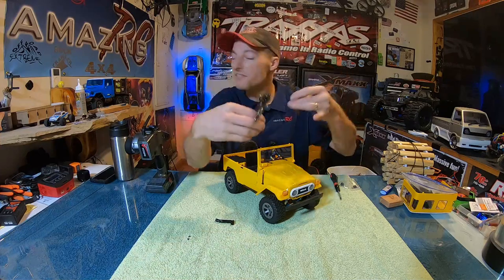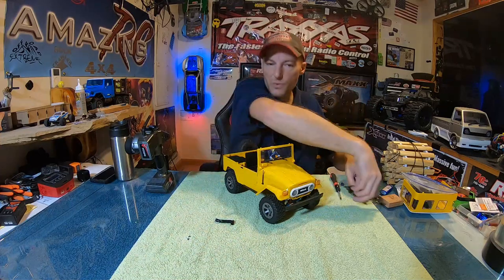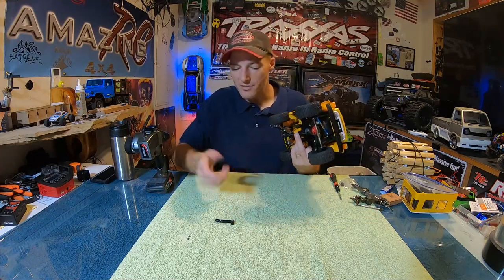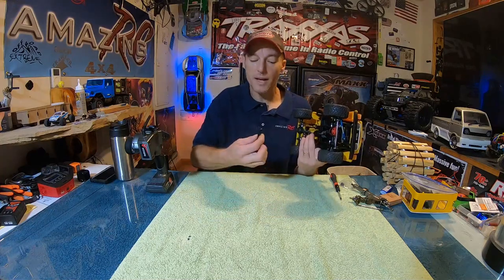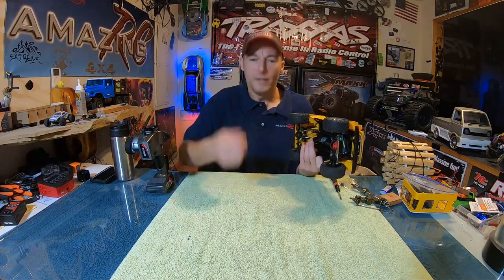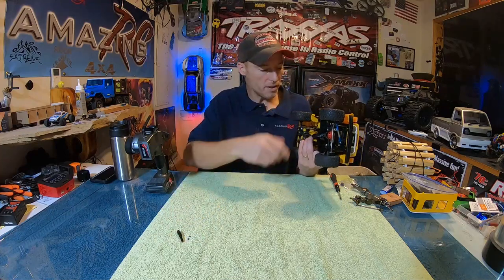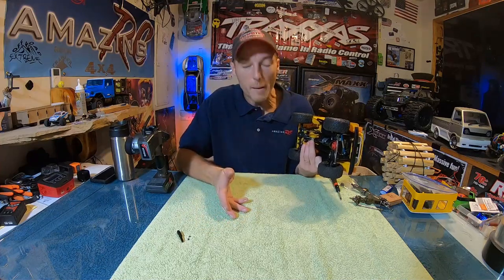What has worked for you? I swear I'll throw them in here and we'll see if we can get a smooth-operating C34. I'm not dead in the water — I do have other axles. If you guys remember, we bought these really nice titanium axles; I just haven't installed them yet. I really do think I'm going to have the exact same problem because I'm telling you it's in the drive shaft. I can see it binding up in the back. I'm going to take this back one out and throw in another new stock drive shaft to see if I can get better results.